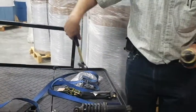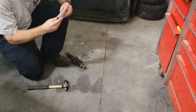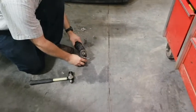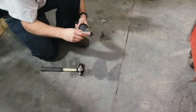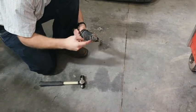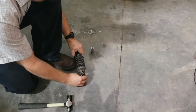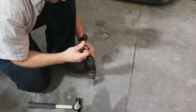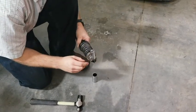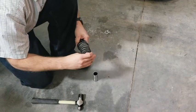I've got a hammer here and a few sockets. This is a one inch — I hold it under here and it fits pretty good. It has to clear this bushing area. A 16 millimeter fits perfect in there to adjust the bushing, and the collar here is not going to interfere.